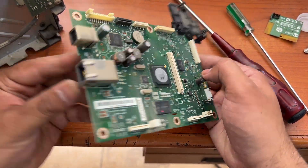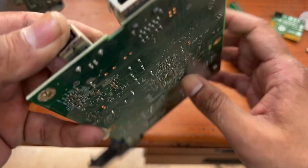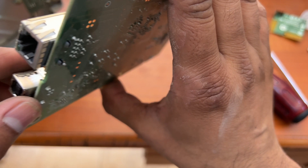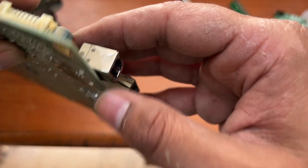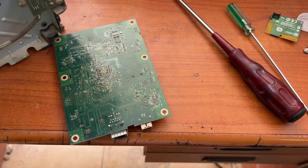Okay, there is no connectivity. This USB port is broken. You can see the legs are broken from underneath — it's totally loose. So we have to replace this USB port and then we will check. We will replace the main board because it's not fixed well.